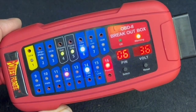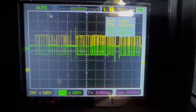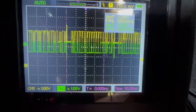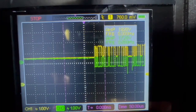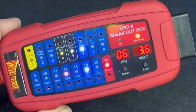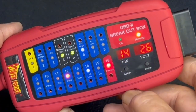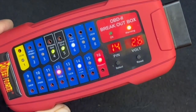The CAN low signal on pin number 14 is actually the opposite, or a mirror image, of the CAN high signal. It's also a 1 volt pulse but it starts at 2.5 volts and drops to about 1.5 volts. Again, the PP-ECB voltmeter will display the max voltage number, so an appropriate CAN low reading should be about 2.5 volts. Comparing the scope voltage to the meter voltage, the PP-ECB is displaying an expected voltage reading.